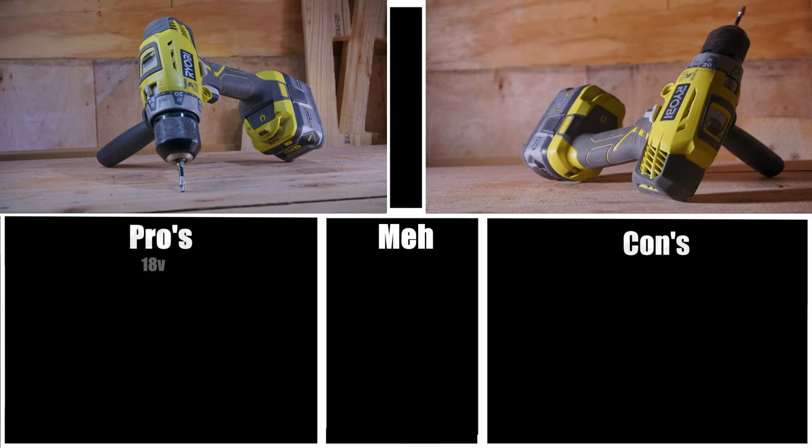Let's go through the pros and cons. Pros: 18-volt — you'll be able to find battery adapters via third-party manufacturers and it works with all your 18-volt Ryobi batteries. Good power — while this isn't the most powerful drill, it's powerful enough for probably 90% of projects around your average house. Metal chuck — the internals and outside of the chuck are metal, which some people really like. Magnet — definitely a useful feature coming in handy in a variety of situations; I'm sad to see it went away on newer Ryobi tools. Bit holder — another useful feature that disappeared off the newer generation, very handy to have. Auxiliary handle — not the strongest or best design, but at least it's there and still a very useful feature.